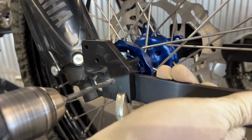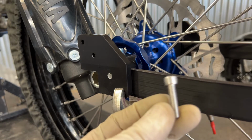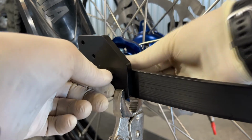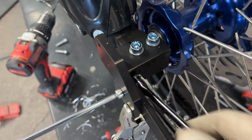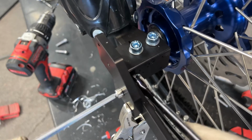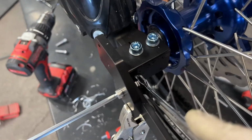The vice grips hold the hoop in place, and I personally like to drill through the pilot holes and the hoop all in one shot. Holding the hoop in place with the vice grips makes sure your parts stay where intended, as well as make sure the holes are concentric. Grab the larger M6 bolts from your hardware kit. Supplied with the kit is nylon lock nuts. This is to stop the vibration and loosening of the fasteners over the season.